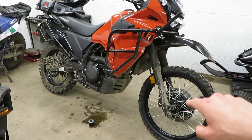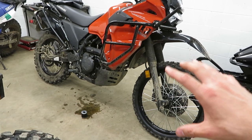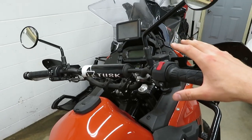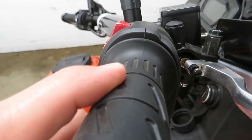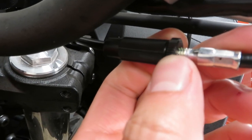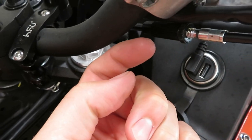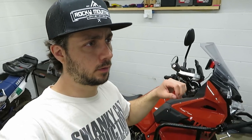One thing I've already done is go through and check all the spokes — look up a video on that but basically just make sure none of them are loose. A lot of the other stuff should be part of your pre-ride check, like throttle free play. In both positions there should be a little bit of slack. If yours has no slop, crack the locking nut loose and spin the adjuster counterclockwise to add slack into the cable. I've already had to do that on this bike and on my Gen 2 — it had rattled itself to where the throttle was locking up past about an eighth of a turn.